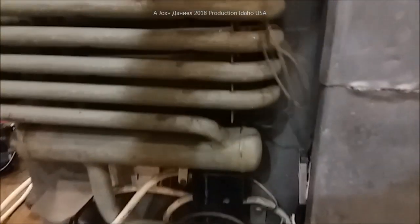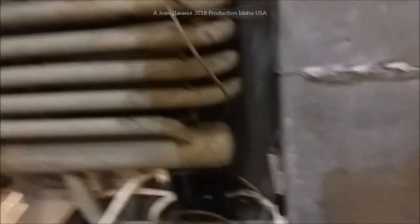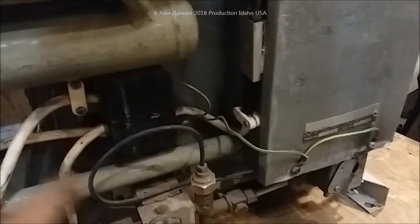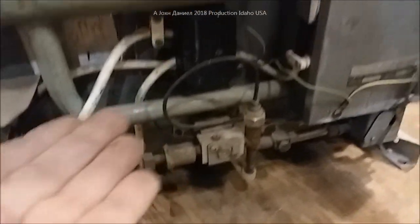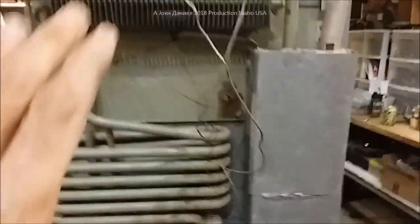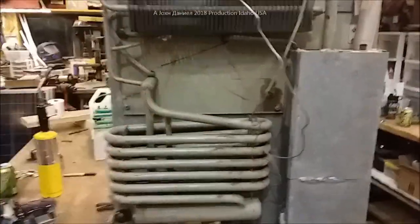The rest of this is pretty straightforward - there are screws here, screws up in here, and in a few other places. Your thermostat lines can just come out like so. Down here we've got to open up the electrical box to disconnect everything, and the rest will just slide off and lift up. This whole cooling unit back here will come off - I'll show you that in just a second.